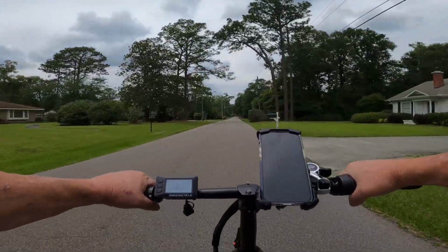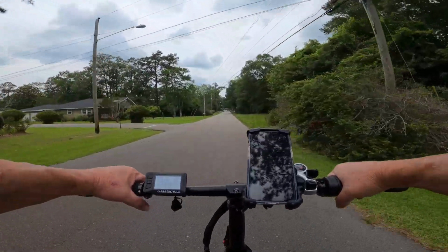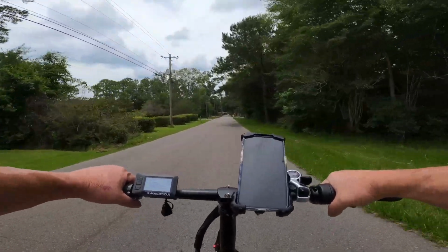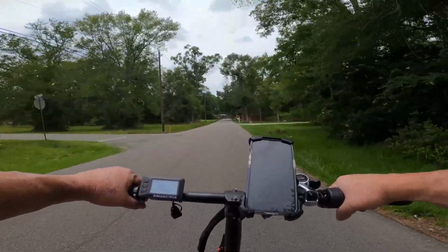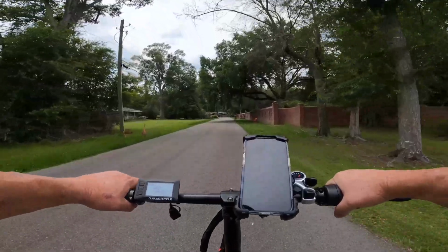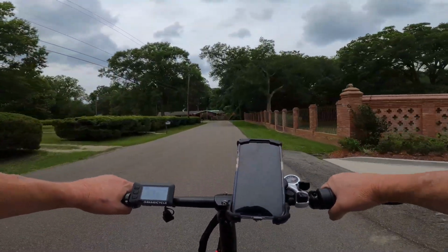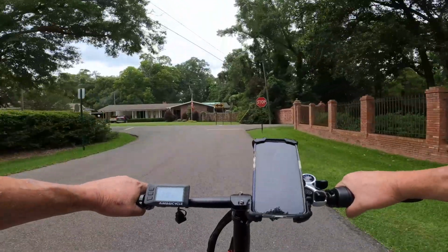We're in pedal assist level 2 right now. We're getting about 13.6 miles per hour. When we bump it up, pedal assist 3, that's 16.8 miles per hour. Pedal assist 4, that's 19.5 miles per hour. Now I am ghost pedaling, so I will be looking at putting an 1128 or 1134 freewheel on it, because I like to feel a little tension in them pedals when I'm pedaling.